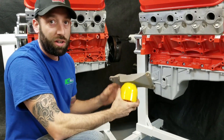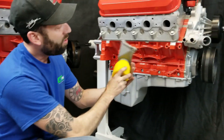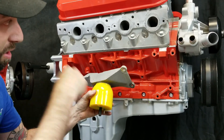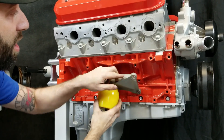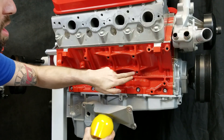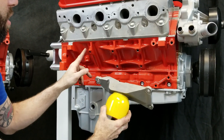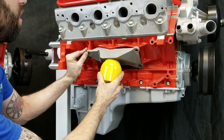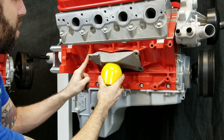If you've ever worked on a CTS-V, if you look at the mounts here, this is a factory mount from an 05. This has normal four-hole mounting holes like on a truck block. The aluminum blocks will have this extra hole, and on the driver's side there'll be two extra holes, one here and here.